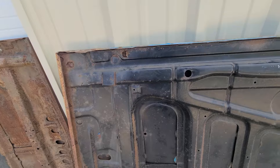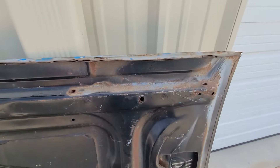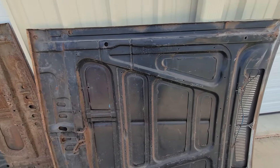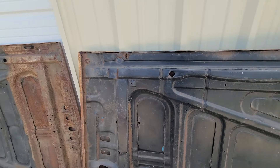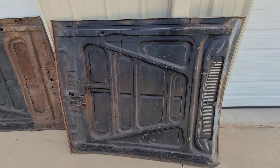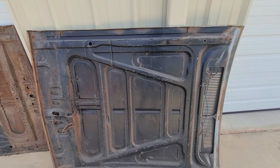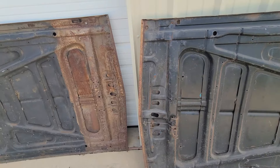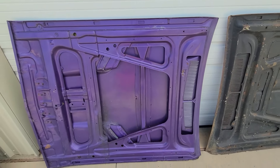So those few things make it very simple. When you're looking at a shaker hood, if somebody takes a hood that has no rectangles and stamps it and puts a shaker in it, claiming it's original — well, there are other ways to check shaker hoods, but that's the quickest way. It's not even a 70 or 71 hood. There are a lot of people out there claiming they have a 1970 to 1974 hood — but that's not true. You have 72 to 74 which are similar, and then 1970 and 71 which are totally different.